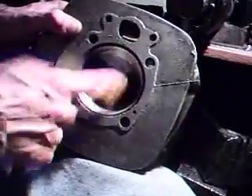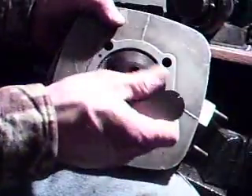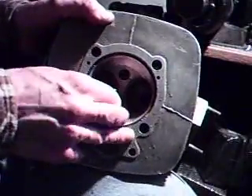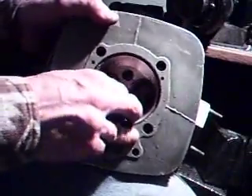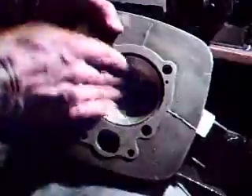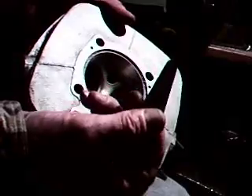I don't want to change the shape of the hemisphere too much, I just want to smooth it out using the right edge of this, and not try to affect the valve pockets too much — I don't want to really touch the edges of those at all. And that's pretty well cleaned now. I also brought it out a little bit so that it would match the barrel better, and I took it out here with the smaller edge of this.